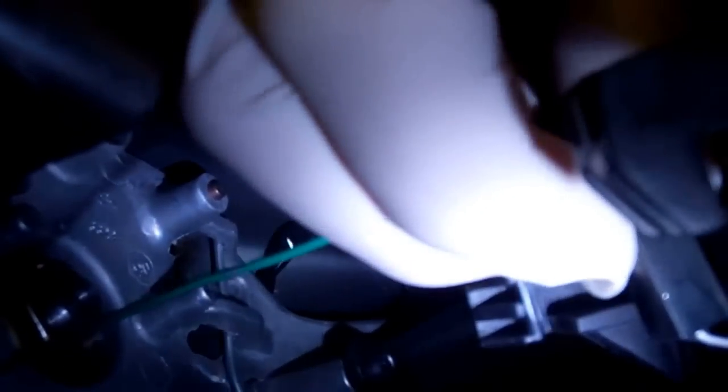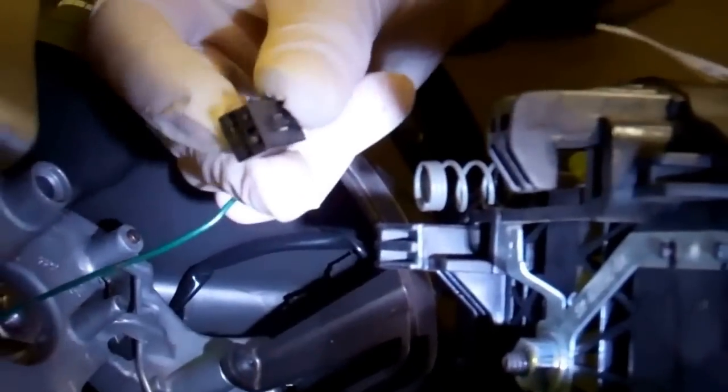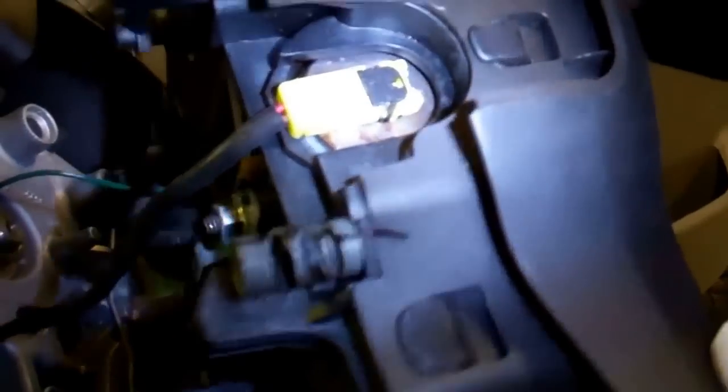Be careful when you get the airbag off — you haven't got much room to move. Position the airbag enough to see the big black wire coming around — it's under a clip. I'll just release it from the clip, which gives us a bit more length. Now we're going to release this connection here — that one just pulls off. It's got a locking edge but it just pulls off.